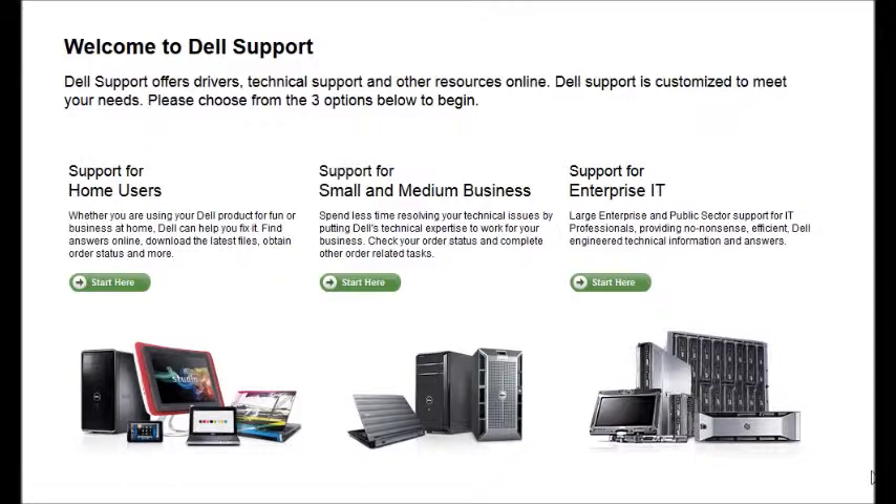Obviously if you're pre-ordering you will come to Dell's website and get the parts from here, although on the parts list that they have on the website it does not show the motherboard 99% of the time. For those cases, either if you've worked on a unit like that previously, you can look at your past emails and see which motherboard you ordered. But I would recommend in those cases just go on site and get the part number for that motherboard from the motherboard itself.